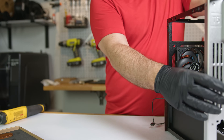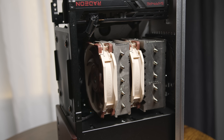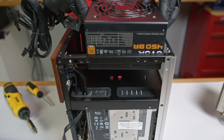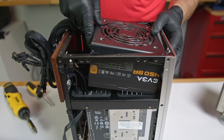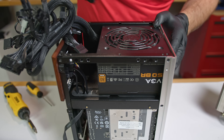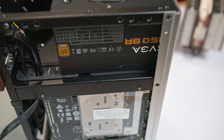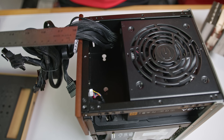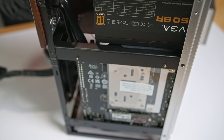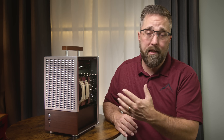Because of the tight space and the fact that most wires and cables run along the front of the case, I went with two 15mm thick Arctic P12 slim fans. Even though it's a mini ITX case, it's compatible with full-size ATX power supplies up to 140mm long. However, you'll notice that an ATX power supply completely covers the rear cable pass-through, so all your cables will need to use the front one — this is why the 140mm length restriction exists, as anything longer covers that front pass-through also. The extra space in front of the PSU is the only place to store excess cables. You'll want to install the motherboard without RAM or cooler attached before routing your cables, as the DIMM slots are right above the one cable pass-through.